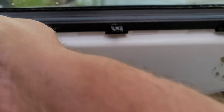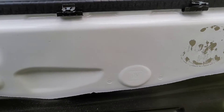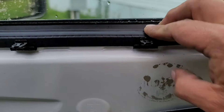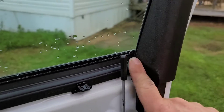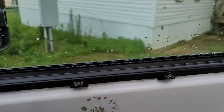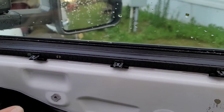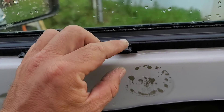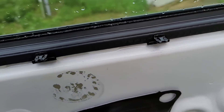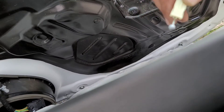What you have to do is pop these little clips out of the back of the door panel — they just squeeze together and pull out. Slide them back on. There are little places they fit right here, so go ahead and slide all those on. Then your weather stripping slides right back down like this — it's tapered on the ends. Get that to fit back in, then slide the door panel front end first. Drop the back end as it goes, and once it slides down far enough you've got to fish the door lock through too. Once it goes down far enough, that will pop on.